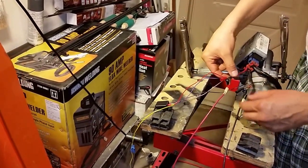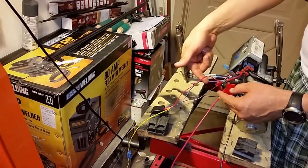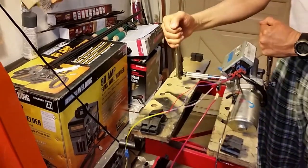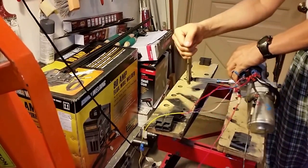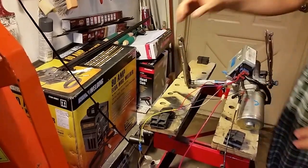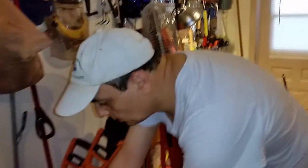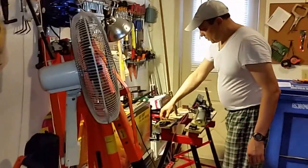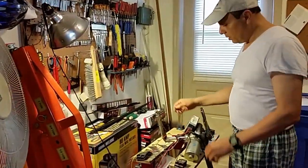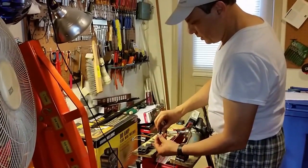The two final cables are just connected to battery power. This usually goes to ignition — I just connected it to a constant positive for testing. I have a couple of tools here just to tell me when I am getting assistance or not. Since I'm just doing a quick test, I connect all the power into my battery here. After you connect, you can hear a little click from the controller that means it's working. I'm just going to turn the knob to the right for maximum assistance.